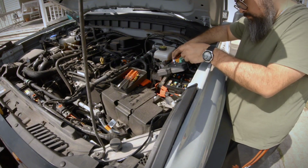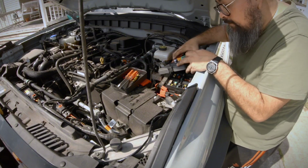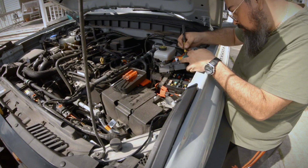I installed an aftermarket switch panel. It comes with a controller that I installed under the hood, and a remote gets routed into the Bronco. I wired the grill lights to my controller box. This way I can choose when to run my grill lights.